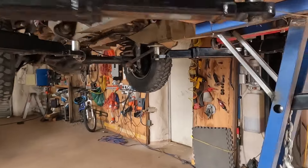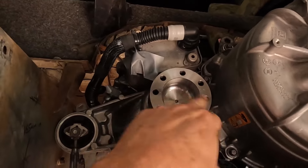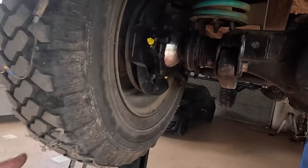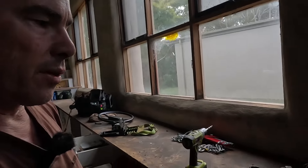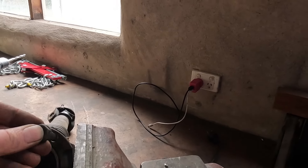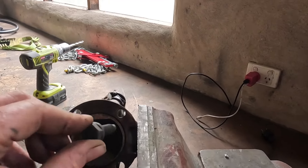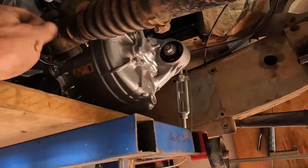These Land Rover outputs from Felton are designed to mate up to the Land Rover prop shafts. Land Rover prop shafts typically use a three-eighths UNF bolt, but they're not three-eighths - that's M10. Three-eighths equivalent in metric is a bit more than 9.5mm. The M10 won't actually go through there normally, but that's okay - I'll just drill it out to M10, it's hardly any difference, just a tickle.